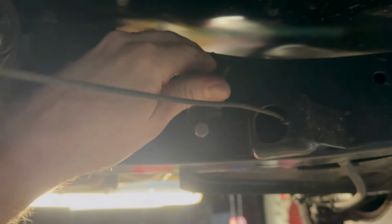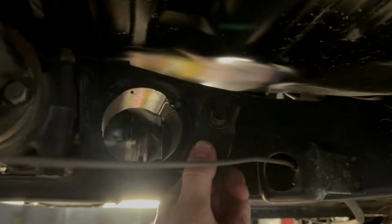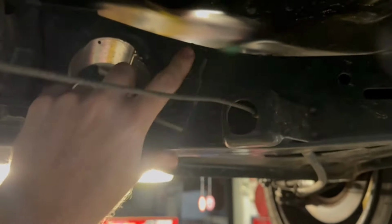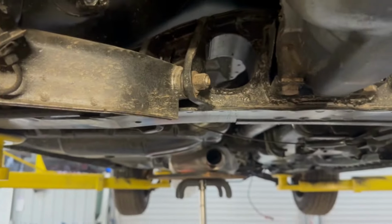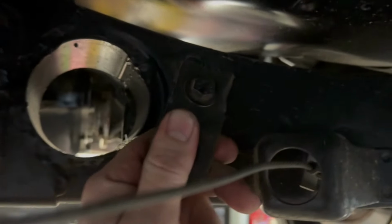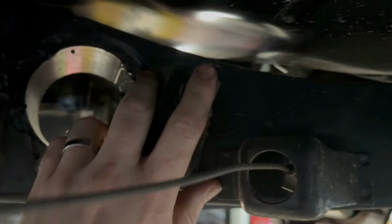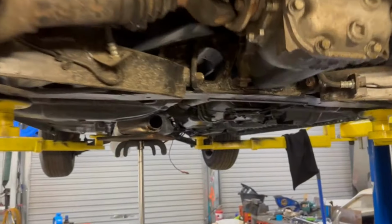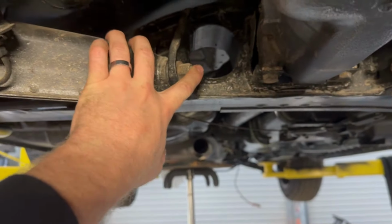So what I think I'm going to do is somehow solid mount. This is an old mount that the previous exhaust was on. I'm not going to utilize this part of it, but I will use that bolt and we'll make something happen there. I think we can make a small bit of plate, bolt it to this bolt, and use maybe a bit of this rubber between the mount and the bolt, just to reduce the vibration noise, because it's still going to make some. Hopefully that reduces it anyway.